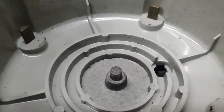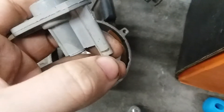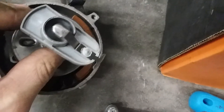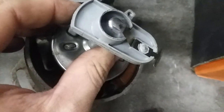So when do you want to replace it? You can see that my center lug is pretty pitted. Another good test is if any of these posts are loose — just replace the cap. You can see this one is pretty pitted and my concern is that it's been wearing the plastic where it's been sitting inside the channel. The plastic will wear and not the channel, for good reason, because the plate can be hard to find. You can see this moves some, and that could affect your timing.